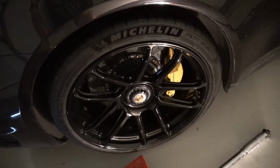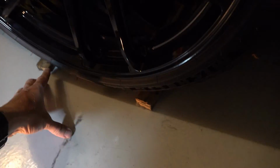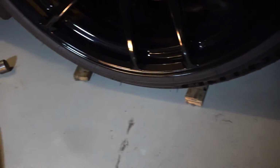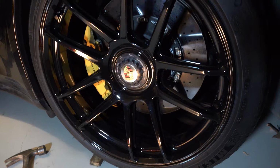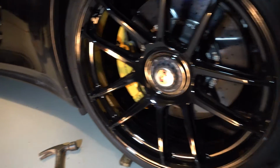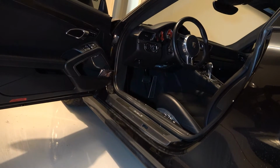The other rear wheel's been installed in the same way. Before I do the front wheels, I moved my 2 pieces of wood and knocked them in underneath the rear tire, both sides, to hold that still. I believe the parking brake only works on the rear wheels, so to do the front wheels, I'm going to have to brace the wheels with the front brake pedal.